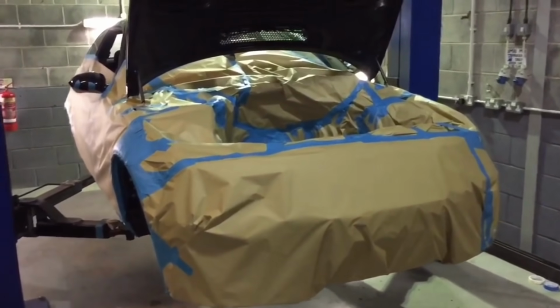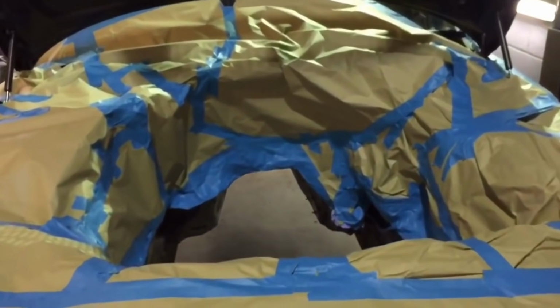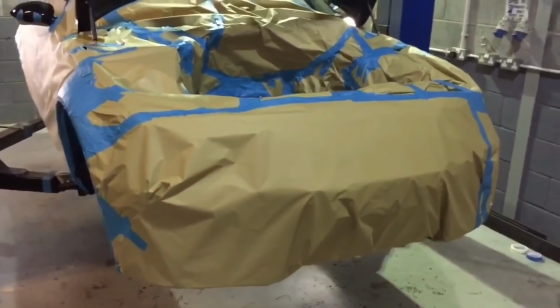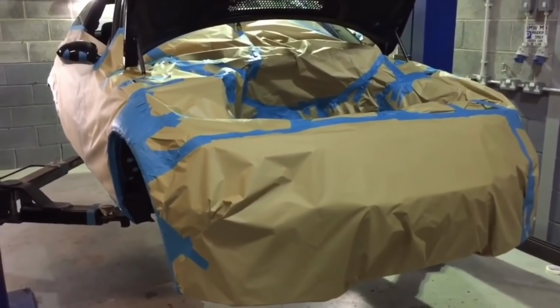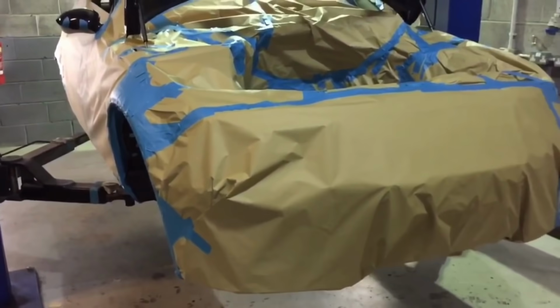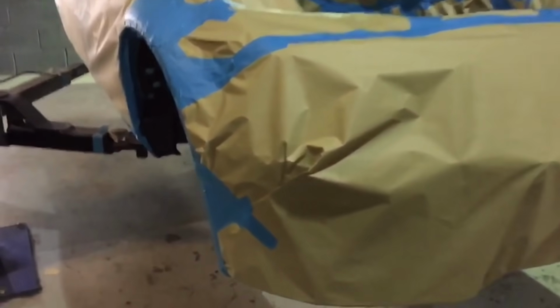The CSL is nearing ready for paint now. As you know, the engine came out a while back. And we just spent the day masking, just so we got the tops of the sides of the chassis legs ready for a little bit of colour there. And then this is just the first mask, just from the underside areas upwards, and then shortly we'll put a genuine BMW body shop cover over the entire car and then mask that to this brown tape.